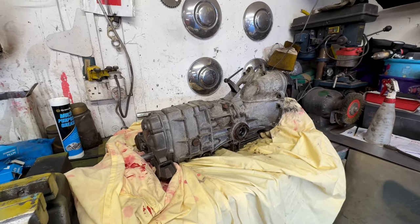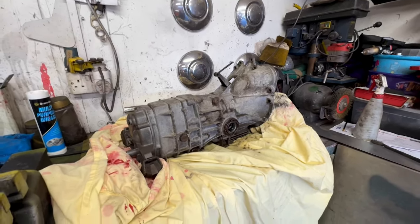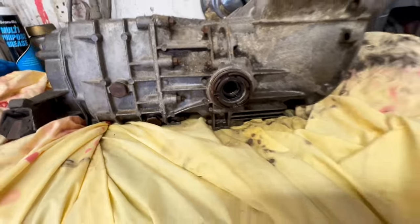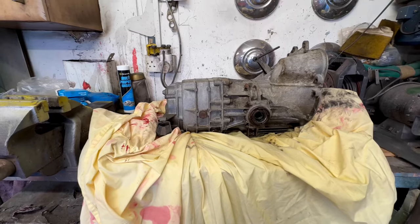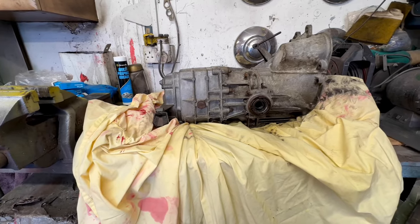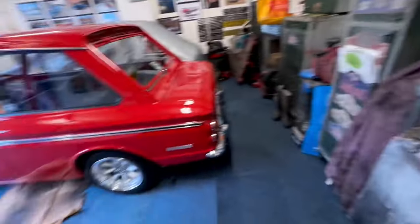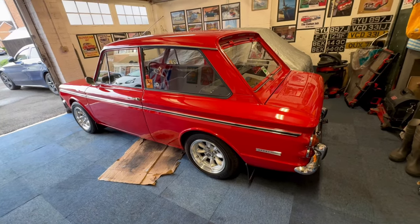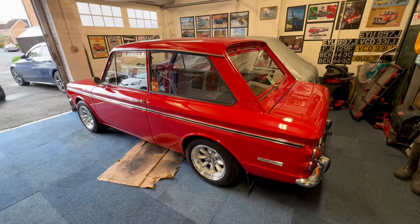It's Wednesday evening and I'm going next Friday. The plan is to clean this gearbox up — it's not actually that bad. He's kindly put some new seals in the gearbox drive shaft flanges. That spray is just my carb cleaner I've sprayed on. I'm going to get the wire wheel on it — not tonight because I'm out tonight. Wednesday night, clean it all up, paint the sump plugs black and these bits here black, then that one will be coming apart and the new gearbox going in. I've ordered my oil today, 80/90 GL4.